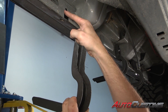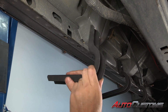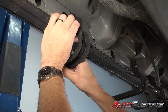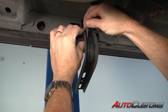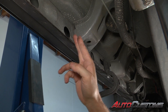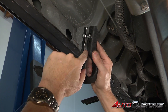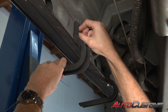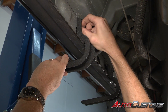The next bracket back is going to go just past the small square hole and next to this oval hole. We're going to have a hole in the pinch weld, and this is the only hole we're going to use for this bracket. Just like the front bracket, we're going to run a bolt through the bottom, then use the provided flat washer and provided serrated flange nut and leave that finger tight. Next, we're going to move back to this round hole — again this might be covered by tape. We're going to install this just like our number two bracket and drop that into the round hole, finger tight. We're not going to use any bolt into the pinch weld — we're just going to set this in at the rocker panel.